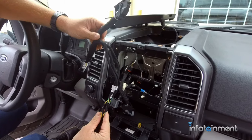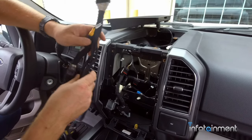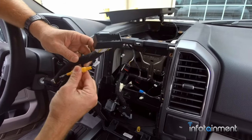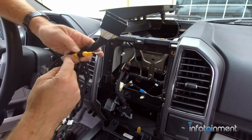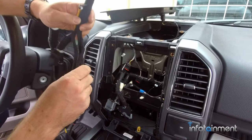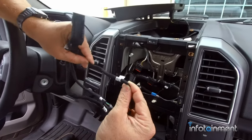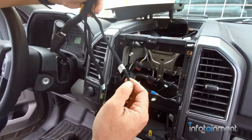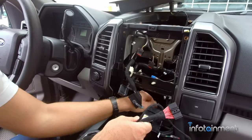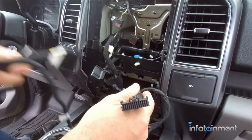This is our main installation harness. This harness serves a lot of different purposes. It has a camera input here — most 2018 and up trucks already have a camera, so this will always stay connected. This is the RCA in and out for backup cameras, so you don't have to worry about that. There are three cables that are going to come off — sometimes two, but in most cases three. The first one says 'sat radio traveling,' so this strand of wires will actually terminate into a little pass-through which will connect into the ACM connector down here as a pass-through only if you want Sirius satellite radio traveling.